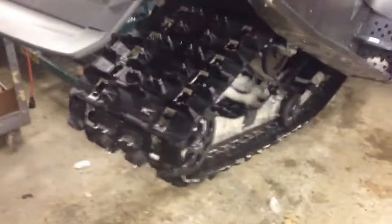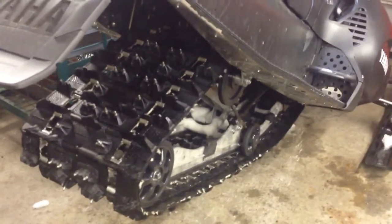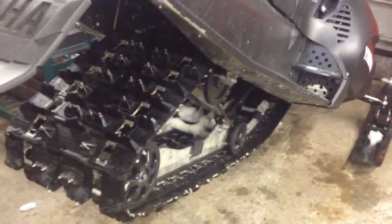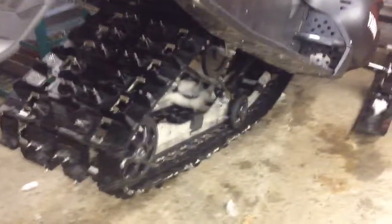So far loving it, loving the studs, loving the backers. I just got to take a little of my transfer out because when I hammer it I have like zero ski pressure. A Yamaha with no ski pressure — just giving that update at 1,300 miles, still digging them.